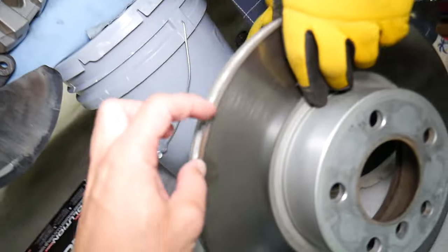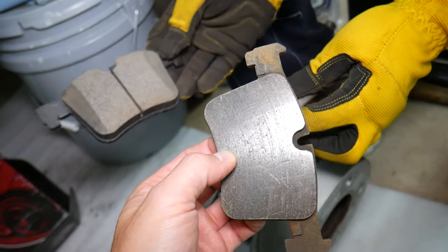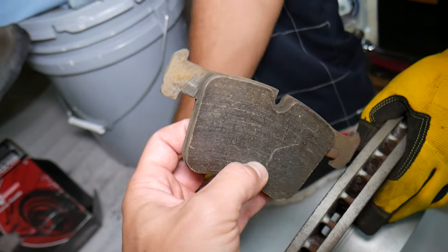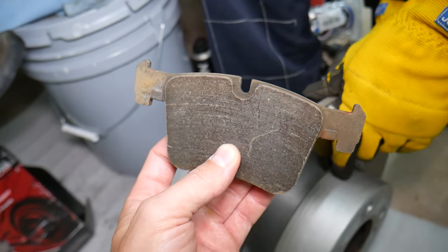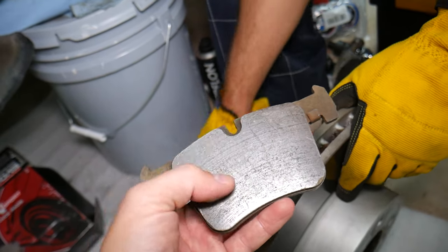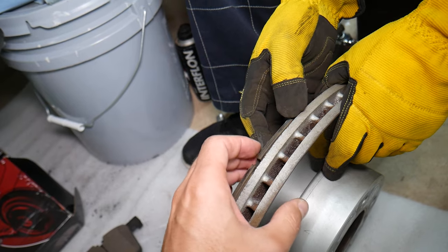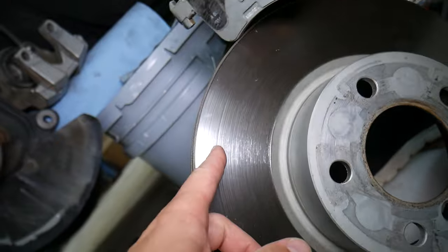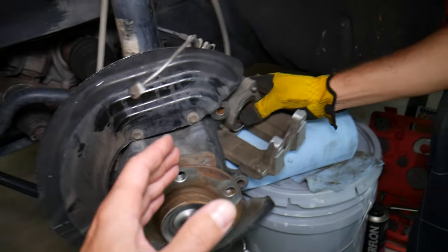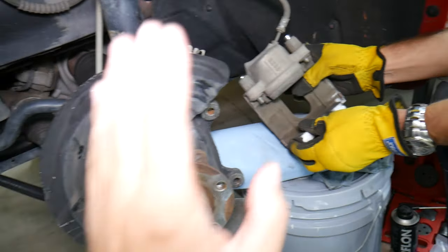One cause: if your brake rotor is really glazed — super shiny — and you have really old, hard brake pads that also have that mirror glazed finish, those brake pads are practically overheated and done. When pads have been exposed to a lot of heat, especially from driving fast, slowing down a lot, or going through mountain passes, it bakes the brakes. Glazed pads require extra compression from the caliper to slow you down, which creates extra friction and extra heat. You'll often notice the steering wheel shaking or the brake pedal pulsating.